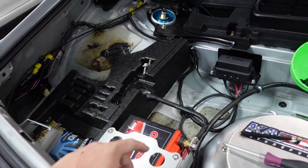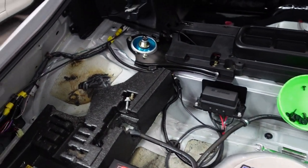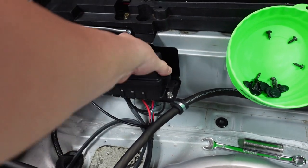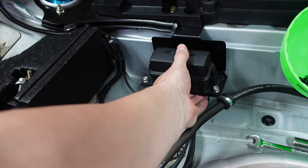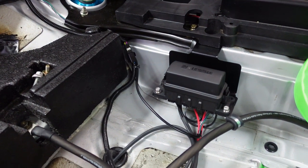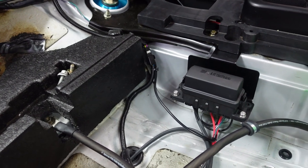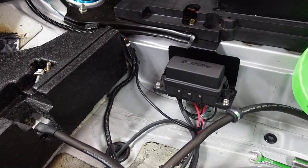I'm going to put it all back together now. Again, I just have to wait till that other wire comes in. I guess it doesn't matter because this car has got to go to paint first. Very basic setup — I love these little fuse setups from Kaizen. Let's see how two fuel pumps do. I've got two 525s. I pray that's enough for what I need. I might have to add a third one. But this setup is only set up to do two pumps.